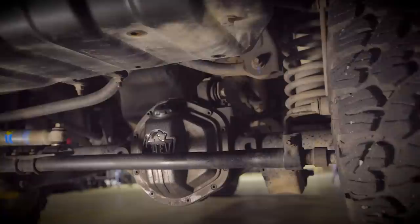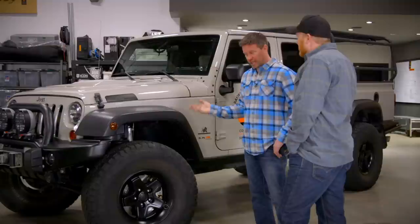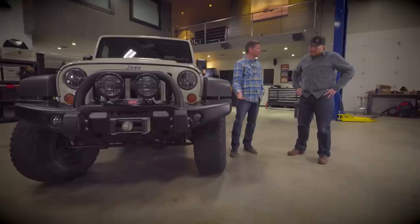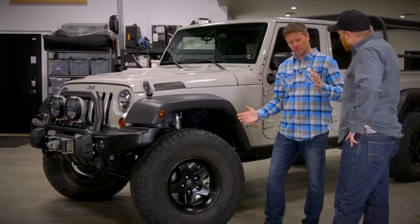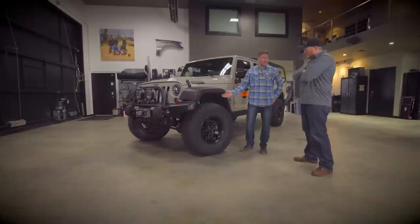Over the years I've kind of landed on this: it's a four-and-a-half inch AEV dual sports suspension with the remote reservoirs, 37-inch tires, on one of our AEV wheels. We've got the Dynatrac big brakes on it, stock axles, Dana 44 Rubicon lockers. Looking at the wheel, we always do these tire warts just to protect the valve stem. We try to give you really big radiuses so when you go to clean the wheels they just wipe easy — you're not trying to detail. They're correct offset, pushed out as far as we can, but not too far where you can't run the stock flare. That bumper's coped out because we do all this study in the computer — tire, full stuff, full turn — make sure we have clearance. It's nice that our suspension works with our wheel, works with our bumper, so you just don't have these issues.